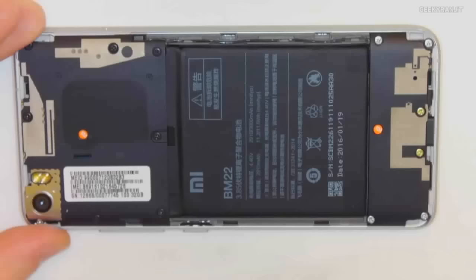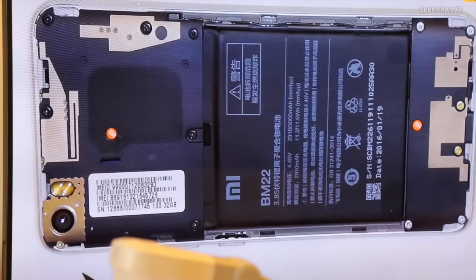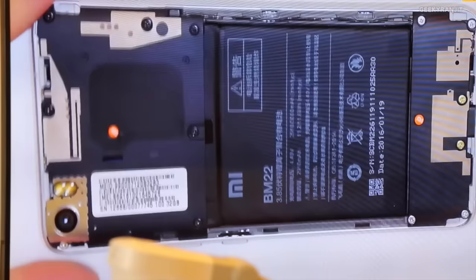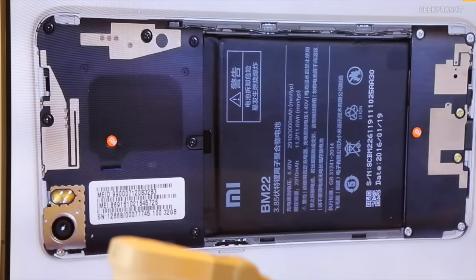And then what you'll notice later is there's a reason why the cover of the camera is done in this metallic material. It's purely because we needed it to be so thin that plastic wasn't enough. The camera module is what determines the thickness of the phone, and therefore we wanted to push things as tightly as possible, which meant that the plastic cover of the PCB was too thick. So that's why part of it is actually metallic on this side here.